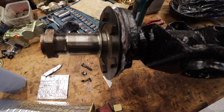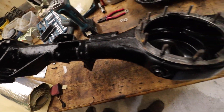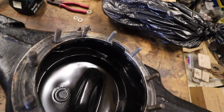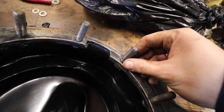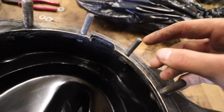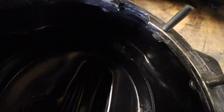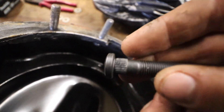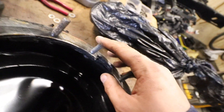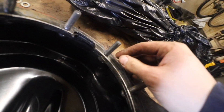As you can see, we've got the stub axles fitted on the freshly painted rear axle. I've also fixed my dad's little cock-up when taking out the diff retaining nuts — he basically rounded them off and got them all spinning in the housing. They're this kind of style nut that pushes into the metal and locks in place. He managed to round them off, but this one, luckily, went back on and wound up with the impact gun and is firmly in place.